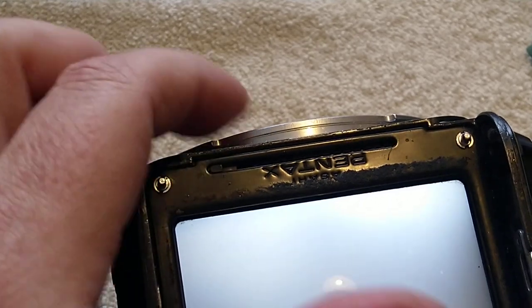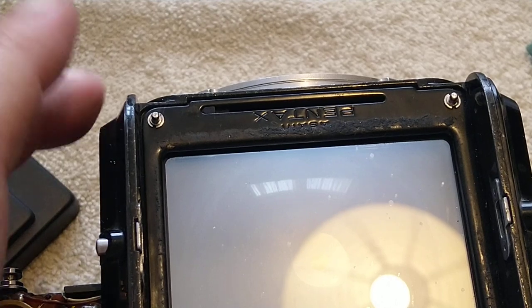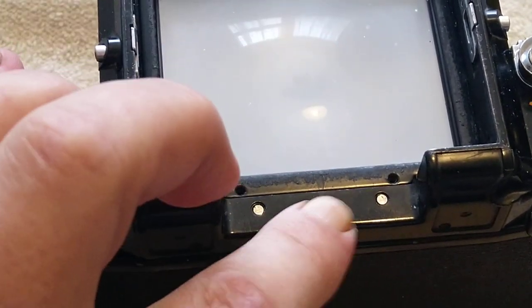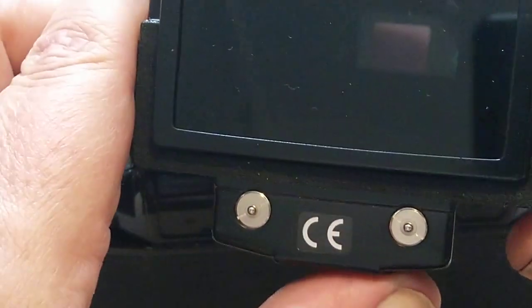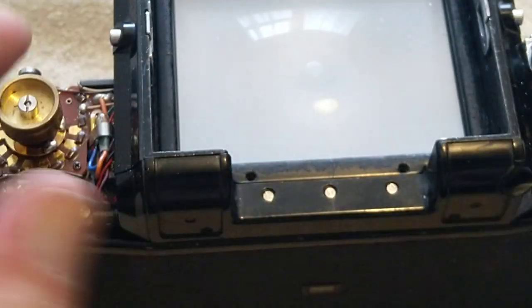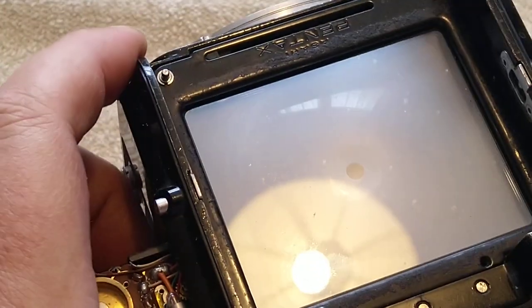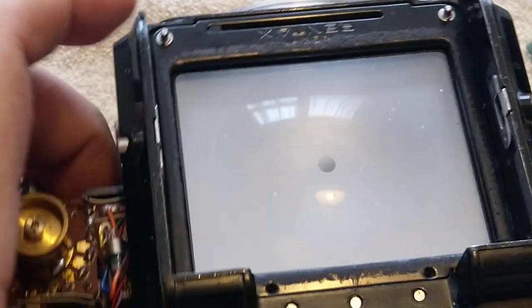So it's one of the reasons why you put the finder on first and then put the lens on. If you're taking the finder off, you remove the lens first and then remove the finder. The camera chassis — the body, the metal part — is actually earth, a bit like in a car, so you only ever get the positive flowing. I found that the wire on this one had rotted away from old age and broken, so there was no power going there. Also these earth pins at the top here were very dirty so it wasn't getting any power.